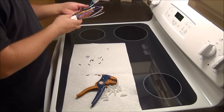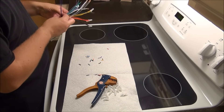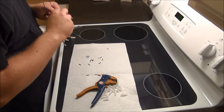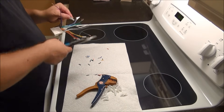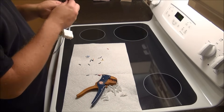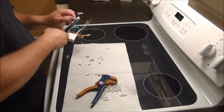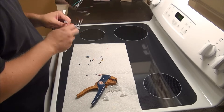The purples — this is your right rear speaker. I always recommend starting with the ones with the black stripe first on the purple set, just to make sure that you're matching them up black stripe to black stripe, which is the negative wire. It's easy to get the purples together but have them reversed, or any of the colors reversed. It's very important that you match stripe for stripe. If you put these backwards you're going to put the speaker out of phase with the other side, which will cause the speaker to not sound nearly as well as it should.